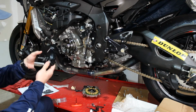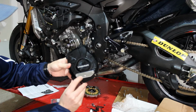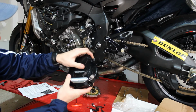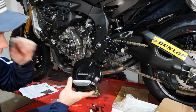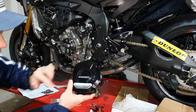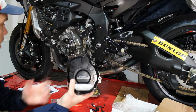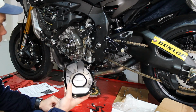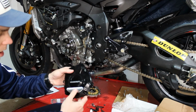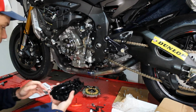And now I'm going to show you what I was talking about. Because I bought the stainless steel version, you can see each of these heads popping through. And that's a really good indication when you get back in the pits. Just take a glance down there, you'll be able to see it right away. A nice shiny stainless steel. If there was any black holes in there, you'd know you'd lost a screw. And hopefully at that point you could stop, check things, and it hadn't worked its way into where it would do some serious damage. But the red Loctite should make sure that none of that ever happens.